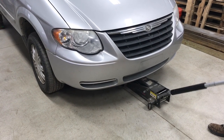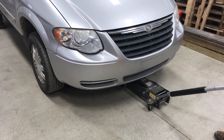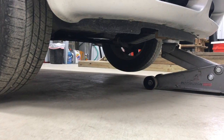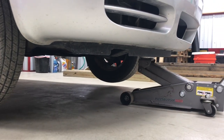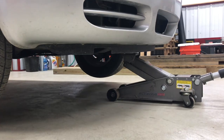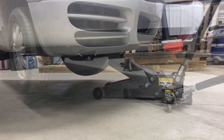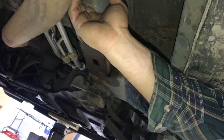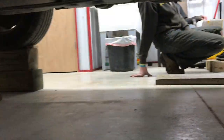Safety is not something that you can redo. Now that we have the back end of the car in the air, we'll start to work on the front. We're going to be working on the front suspension, so we can't use the wheels as part of the support. We're going to have to build structure behind the wheels on the frame, looking for major portions of the frame that we can attach the structure to.